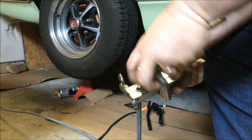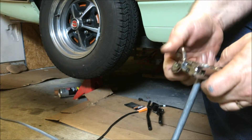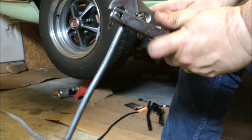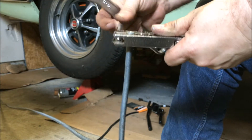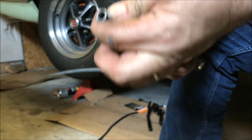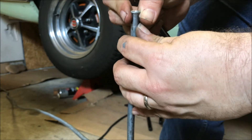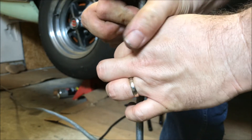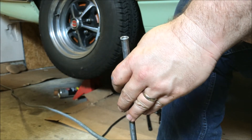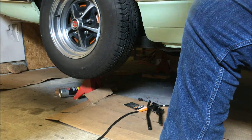It's mushed down — that's good — and then I just loosen it back up and take it off, and we got one end of the line done. Almost looks like third time's a charm and I know what I'm doing — which I really don't. So there's the swage: it's got a shoulder to catch that clamp. The three-eighths hose goes over there far enough and then I put a big Earl's EFI hose clamp on there and it won't go anywhere.